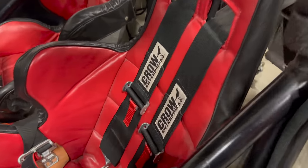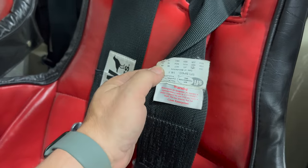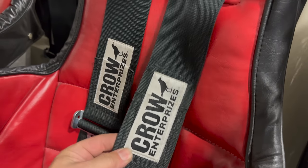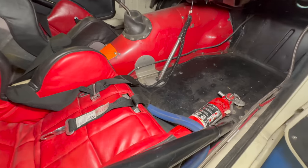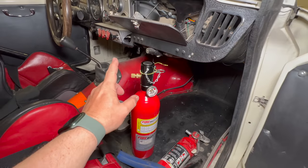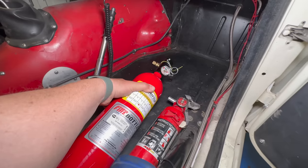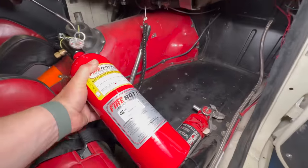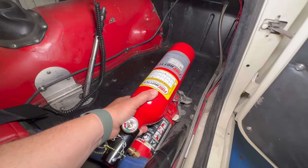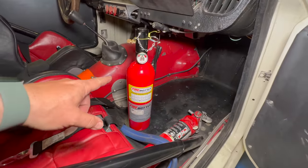Normally here in the United States your belts for vintage racing do not expire as long as they look like they are in good shape. But for this event, being an international event, I'm going to update these. These were made in April of 2013. So I've ordered a new set of harnesses and I'm going to get those installed. And speaking of safety equipment, I'm going to be replacing this fire extinguisher with a full fire system. This will have two nozzles attached to it — one that sprays into the passenger compartment and one that sprays into the engine compartment. You're not supposed to mount it the way that fire extinguisher is right there because it won't work under hard braking. The preferred way would be sideways like this. I'll either mount it that way or the next best way. Before the race I'll get this installed and I'll show you what I've done.